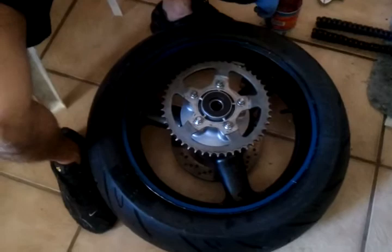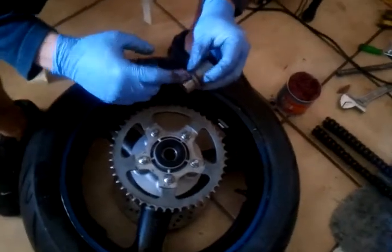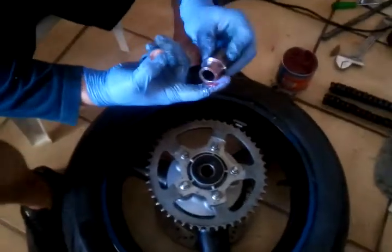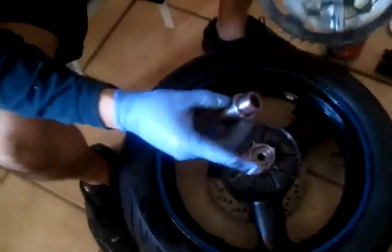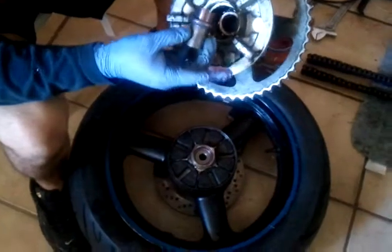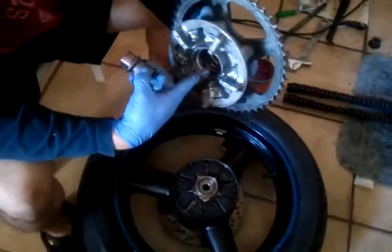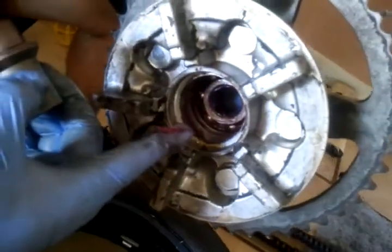I cleaned up the pieces, so you just have to rub a little bit of grease in. Do you have to grease it regardless? Even if it was pretty greased before? That's what I say — I clean the whole thing up and put new grease in, because you don't want grease with all the dirt. When grease is used, you can notice it changes color and gets blacker. So you want to have fresh grease in it.